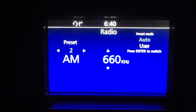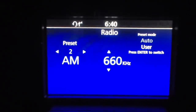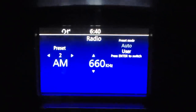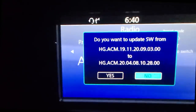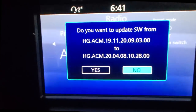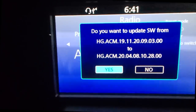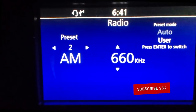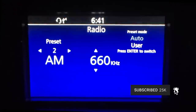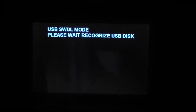You just have to be patient. I timed it and on my bike it was about 35 to 40 seconds before it brought up the option to install the update. After a while you should see a screen asking about the update — the default answer is no, but use your jog dial to select yes and hit the enter button to begin the update process. It may not look immediately like it's updating, but the screen will eventually go black and then you'll see the update message.